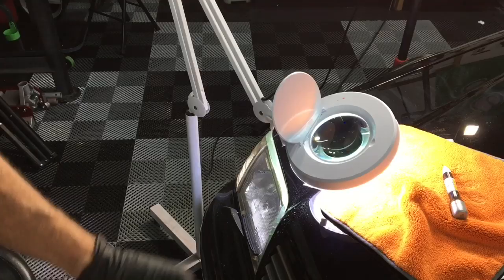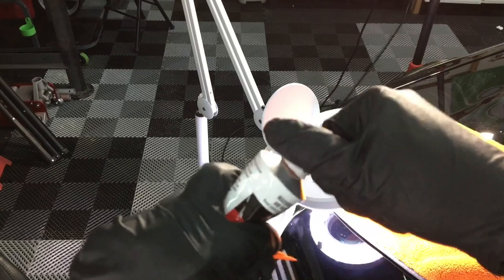This here, ladies and gentlemen, is the expensive way, when I do it anyways, to fill in and repair rock chips because I'm going to need the car for an extra day or two. This is very time-consuming. It is a fill, wet sand process. And when you fill, depending on what you use, you have to let it dry and cure for a day, sometimes even longer, maybe even two, depending on what surface it is, to ensure when you wet sand or polish over it, it doesn't lift that touch-up paint back out. It can really be a tedious, long process.